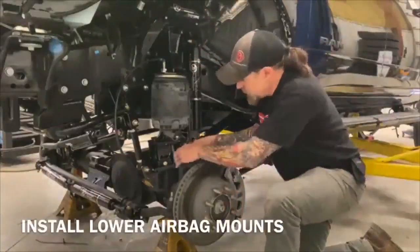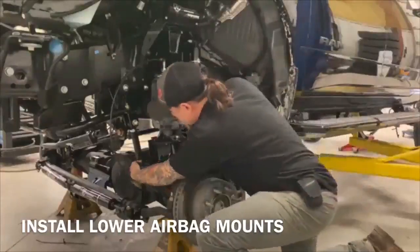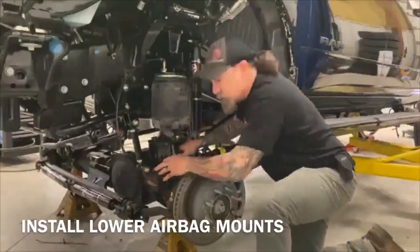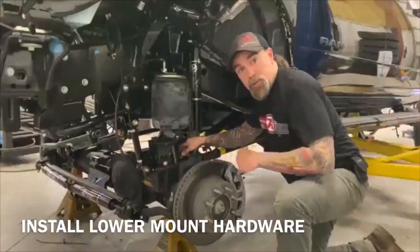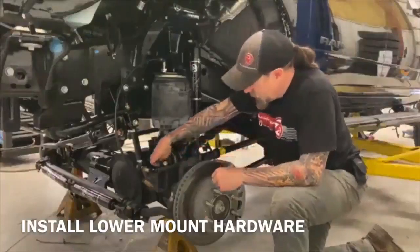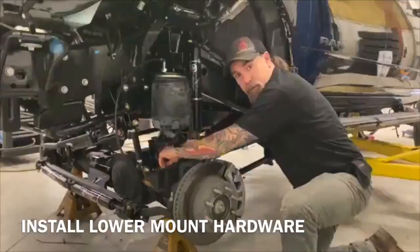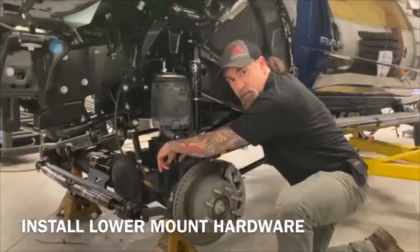The lower bag mount attaches with three bolts. You've got a couple 3/8 bolts on the front, and you've got another bolt back here that you're going to drill and tap — that's a 1/2 inch bolt back there. In between here you'll see a little bit of gap; put a couple washers in there. What we typically do is take a couple flat washers, just put some black tape around them and stick them down in there. Then fasten it in — you can reach in here and get to the bolt heads. It's not real easy, but you can reach in there and get to it.